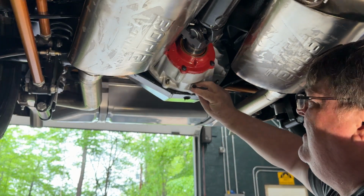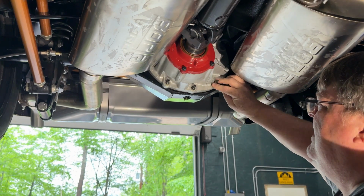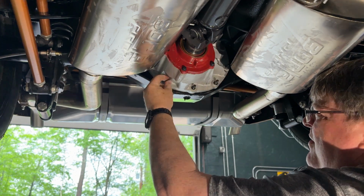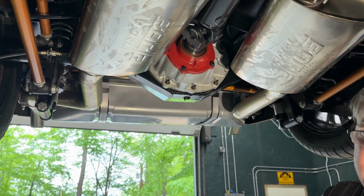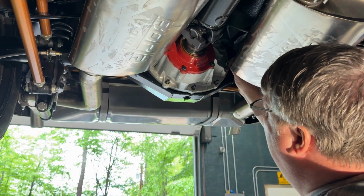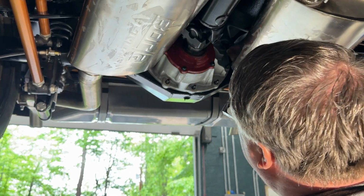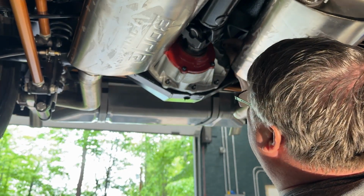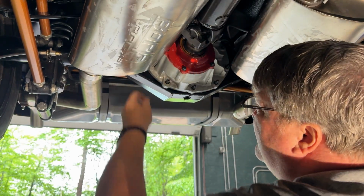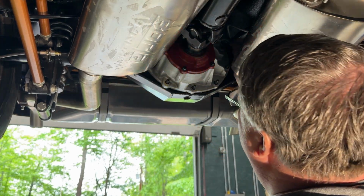So I'm going to go around, slip on these guys. And again, they just got a little rubber interior annular ring, and that will help compress that and should stop that leak. Then we'll address the pinion seal itself, which basically just doesn't look like it's in all the way.